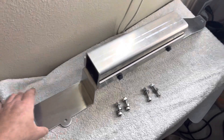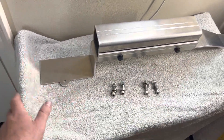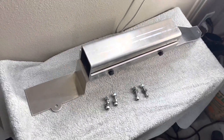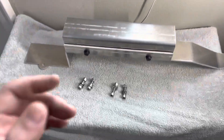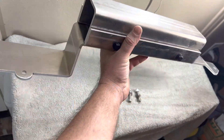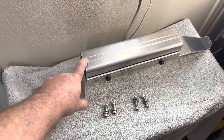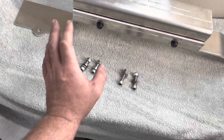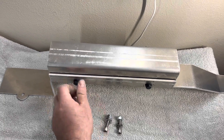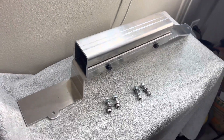So I came up with a solution. What we have here is the shield kit — this is actually the sixth revision. I have one more revision coming for those with the inline six cylinders, which is the diesel guys and the inline six 30i, X5, X6. This is the drive shaft shield. Everything is super simple, super thick, and should keep the drive shaft in position if it breaks and prevent it from damaging and destroying things.